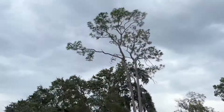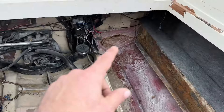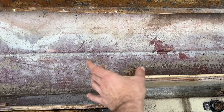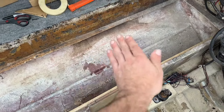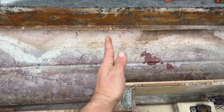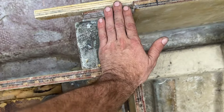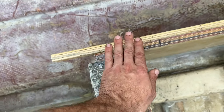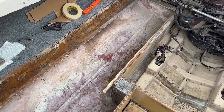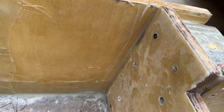I've got to make this quick because we are starting to get a little drizzling here. I don't want to get this floorboard wet, and I don't really want any moisture in here because we're drying out the transom — I'll talk about that in just one second. You guys probably saw the two, three inch gap that was here between the rear floorboard, the stern floorboard, and then the cockpit area — this entire starboard floorboard. They had that gap right there. I went ahead and cut out a nice piece that fits right in that section and also sits right in here. So it comes out, steps over a little bit, and then runs back all the way. Once we go to lay down the floorboards and mix up our cabosil — and this is all cabosil right in here — this is what I'm using to join and strengthen all of my joints.